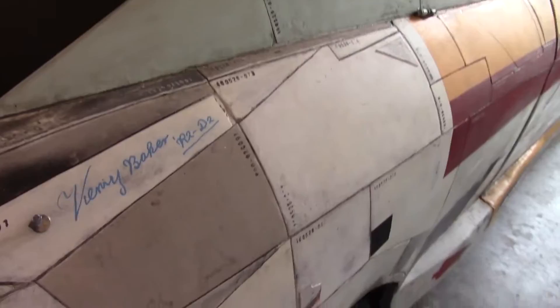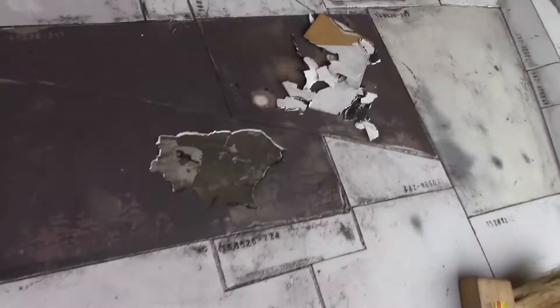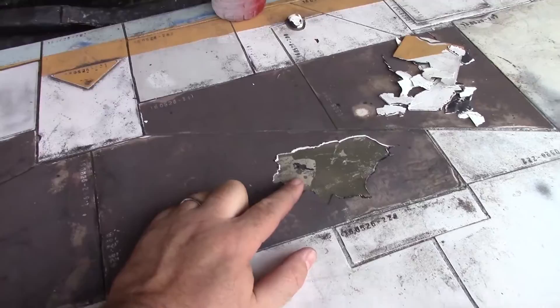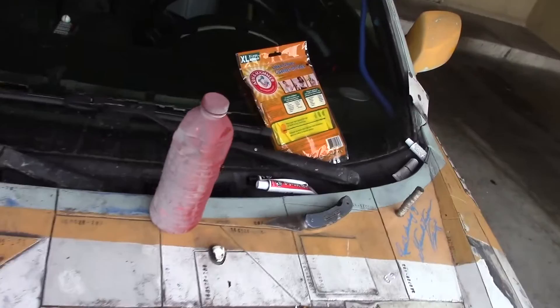Brought a couple other panels with me, but there's no one else to sign them there. These are going back on today as much as I can with the JB Weld that I've got. In the previous paint job, I did damage a couple of the panels — they essentially blistered. Either the paint job blistered, which I popped those, or the entire plastic blistered, so I ripped it off. There's a little example of it right there. So I'm going to have to do some spray painting, get some silver in there, and then some black for damage, and then replace it.